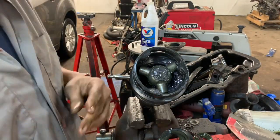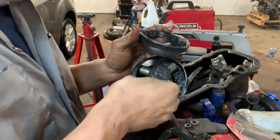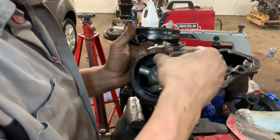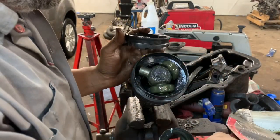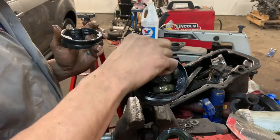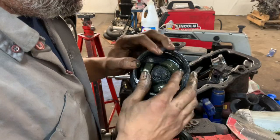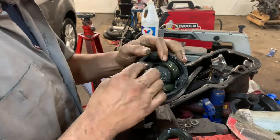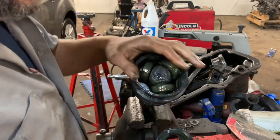Now we're going to go ahead and put our bearings back on in the appropriate places that they went. Remove that to that. Then we'll shove some grease on it. More grease. And you could wear gloves for this, obviously. I'm a non-caring lad, but it's only dirt. It'll wash off. So then we're going to go ahead and we can line up our tangs. I'm kind of feeling like this was the intention of these. Now, snap in the cup, hopefully.